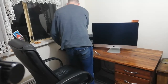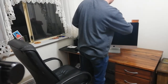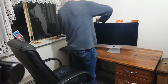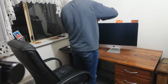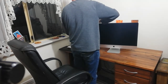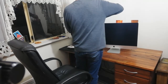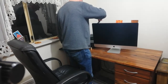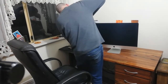Okay, that was good. Another credit card. iMacs are real expensive. And we'll try and do the same on the other side. Taking the knife, wedging it between the screen and the casing and sliding along to cut that glue strip to separate the two halves. Okay, should have that out far enough now that I can use another credit card, hold it out a bit, and then go down the side now.